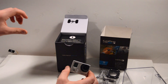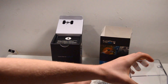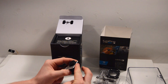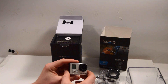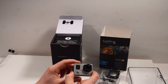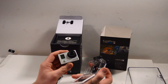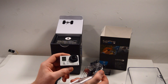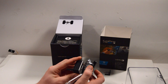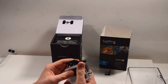Once you've got that done, put the USB cable back inside the box, put the port cover back on nice and tidy, and make sure the camera is fully charged. Leave it plugged into any computer — the red light means it's charging, and when the red light goes off it's finished. You need to make sure it's fully charged, there's a blank SD card in there, and you remember the Wi-Fi password and username you set up when updating.